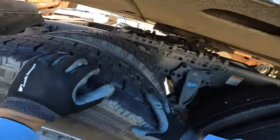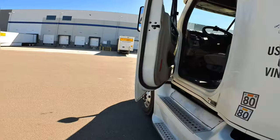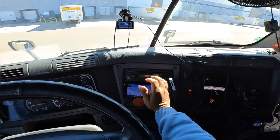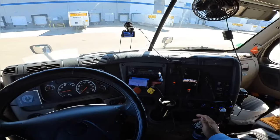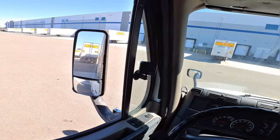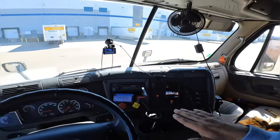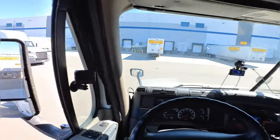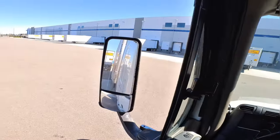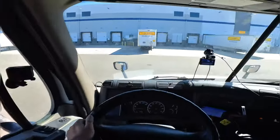Come here, release your fifth wheel. You've released your fifth wheel. You're going to go in your truck. What I like to do is release my brake from my truck, put it in first or low, move a bit, and then I lower my landing gear — just so that it doesn't have that hard hit on it. If you're good, you're out. You're good to go.